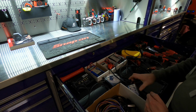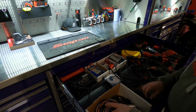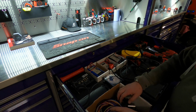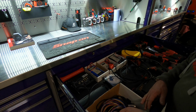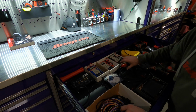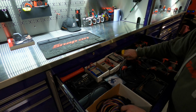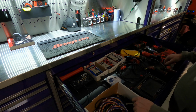We've got speaker testers, polarity testers, setup CDs, things for the DMRTA from Audio Control. So I've got the mic and adapter leads that I can run RCA leads, phono, speaker inputs, and so on. My SMD testers, we've got various ones, from the DD1, DD1 Plus and the CC1, all used in setting up amplifiers and finding gains with vehicles.